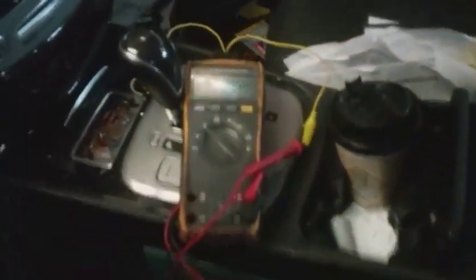I swapped to the other terminal — yep, there we go, 12 volts. Awesome. So that's the thing when you send bias voltage — you're not sending actual current, just in case you have a short. If I were to actually have a short to ground, this light would have come on. So we're making progress. Now I want to always follow the circuit, so since I know this is going to the load, I need to figure out why this is not getting 12 volts.